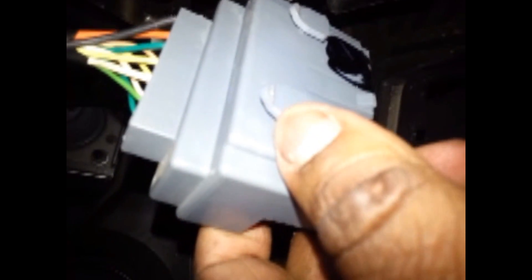When you get to this part and you've got to go up under your dash right here, you're going to have to remove these two screws — there's one screw and there's two screws. I already took it out, but after you take those two screws out, it'll drop down halfway. Then you have to take this clip off — there's a clip that slides off right there. You're going to have to take this off right here — it's clipped on to the bottom. You have to push this one in first and then slide it, and this part will come right off.